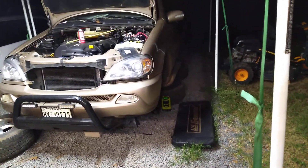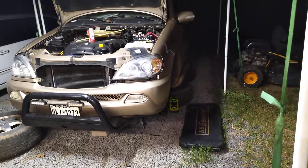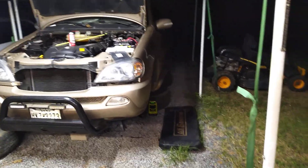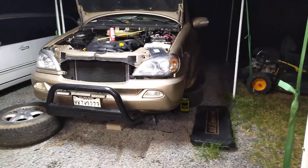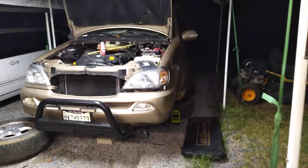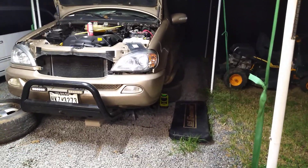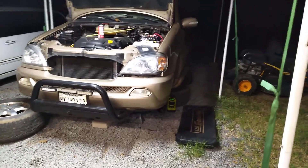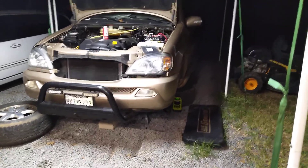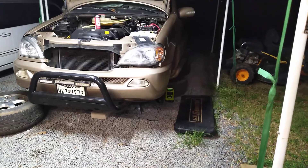I couldn't really find anyone in the forums who had made this error, but I did find a young man from Germany who seemed to have bought an ML430, like a 2001 — so that's a really early chassis — and the prior owner who sold him the car put in the wrong sensors and couldn't figure out the error. The car was always beeping, in limp mode. The guy sold it cheap, like a thousand dollars for a perfect condition ML. The young man bought it and still couldn't figure it out because it's not an obvious error — it takes some digging and a scanner. A shop remedied it for him, but even the shop didn't really say in the thread he posted, 'hey, you had the wrong year sensors.' They just replaced the sensors with the correct ones, the kid was in good shape, and the car was perfect.